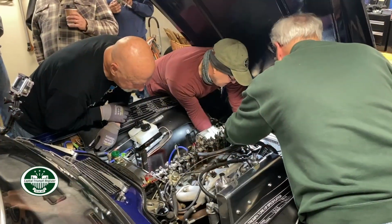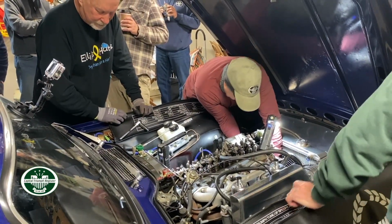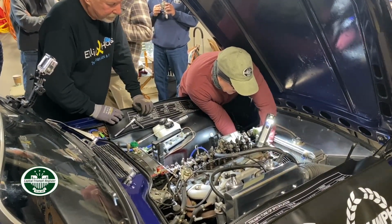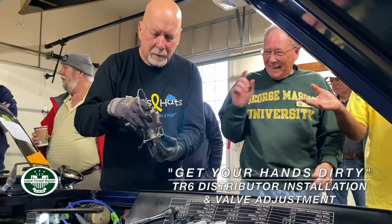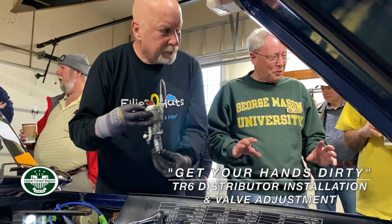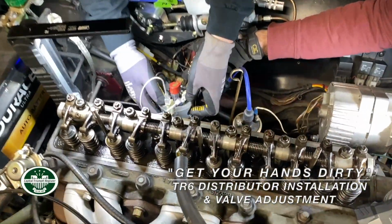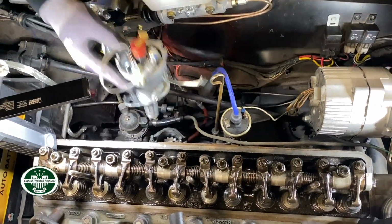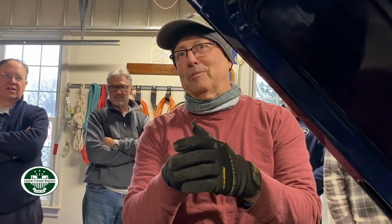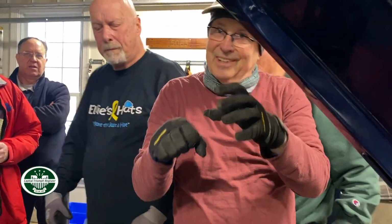Let's try that. So he wants to be at, what did he say, the instructions, 10? 10 static. I had an electronic on there. When I sent it to the guy, he said, I only do points. I said, do points. Okay. So here's the mark, we should be all right. Right there, yep. So the tack cable is one of the problems, right? For your timing, you're turning it, the tack cable hits the fuel. And that's why you go electronic tack, too.